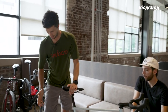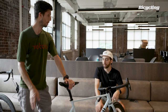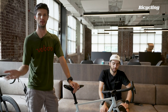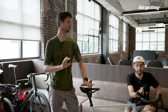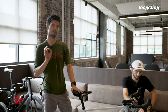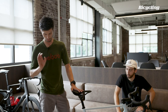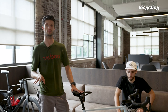The most important thing is there's an extra gear back here — we're now finally at Shimano 12-speed, which now brings Shimano up to SRAM and Campy, although Campy's already working on 13-speed apparently. Shimano managed to fit that extra cog on the existing freehub body, so no new freehub body standard. You can put a 12-speed cassette on your current wheels, no issues.